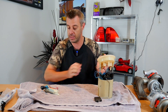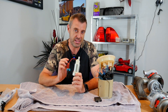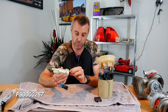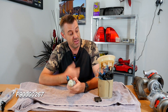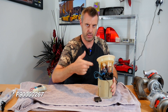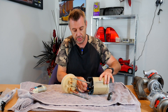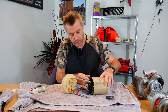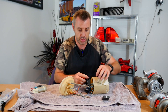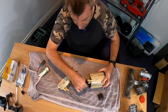If you hadn't seen the progress of this build, the current fuel setup for the low pressure system is based off one Chinese Walbro 460. The part I ordered is the low pressure version of the Walbro, and it's been fine. I did do something a bit weird — I've actually already taken this out of the car. When I installed this, I sort of went against the grain from what most DIY low pressure fuel pumps are, and I didn't use the Venturi system.